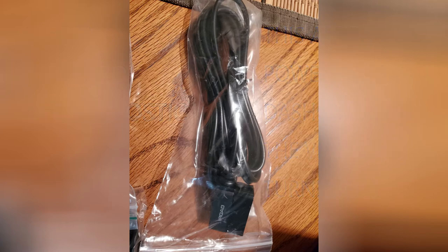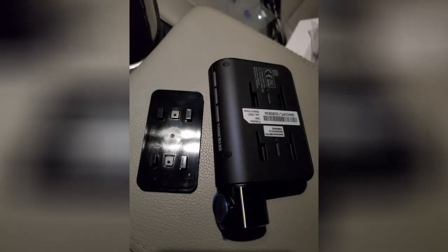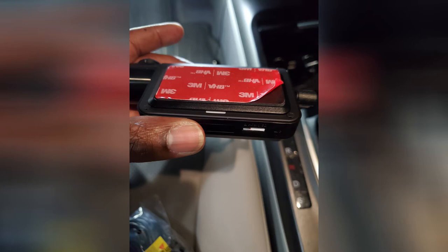One of the first things you want to do before installing your dash cam is pick a location on your windshield. You want to place it nearly directly behind the rearview mirror, but not so close that you cannot eject or insert the SD memory card. Also make sure the window is clean before placing the dash cam. Once you've selected a spot, take your mounting bracket and attach it to the dash cam — do not take the 3M sticker off just yet. When you do remove the 3M film, take off just a corner piece first so you can check that the camera is properly aligned.